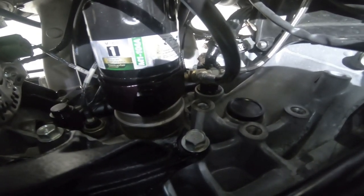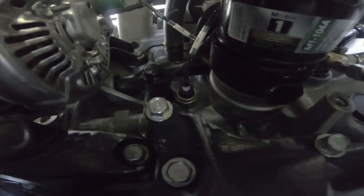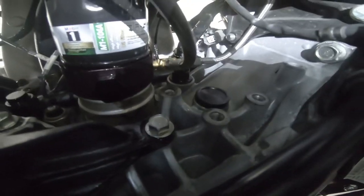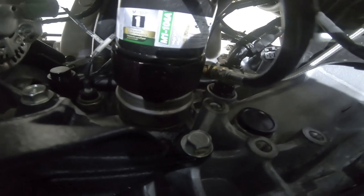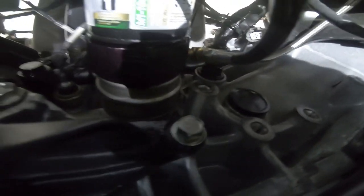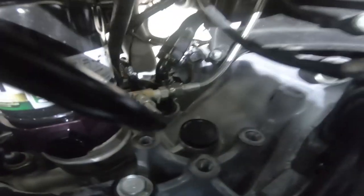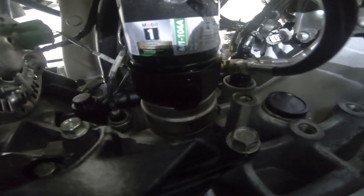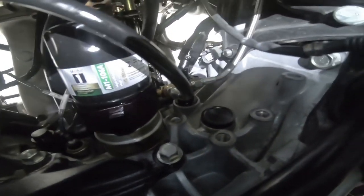The little brass fitting coming out of the side of my sandwich adapter plate is intended to plug into where your stock oil pressure sender for the dash dummy light goes. I already had the sandwich plate installed, so the stainless line going there is my oil pressure gauge — originally tapped straight into the sandwich plate. The brass fitting from the Go AutoWorks kit I screwed into the sandwich plate adapter. It's essentially a T: it screws into there, the sender unit screws into that, and then the oil feed line connects. My feed line goes up, around, and into the turbo, so it's getting filtered oil now.